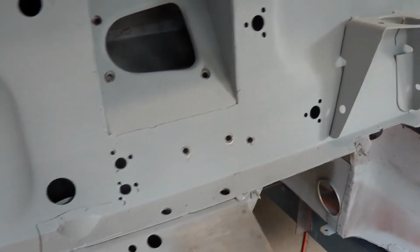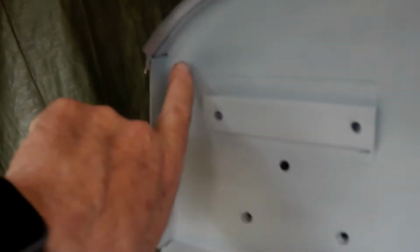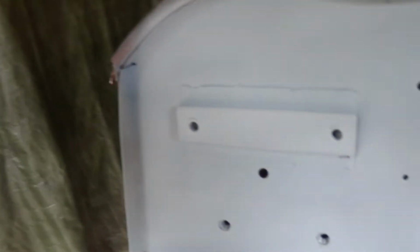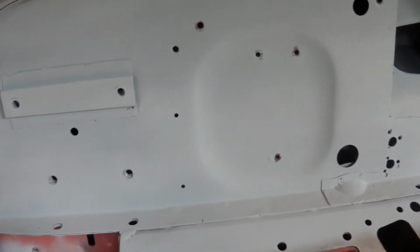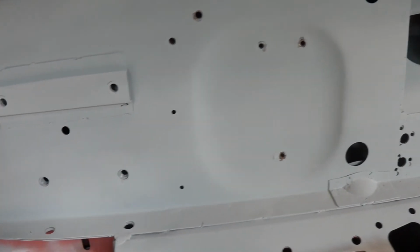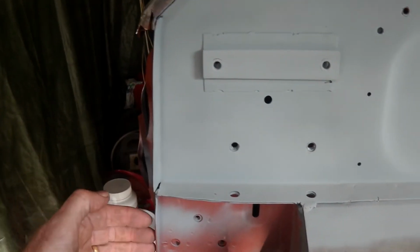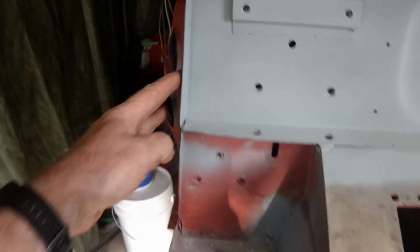So there was sealant all around here, around the edges there. So I thought I'd actually do that progressively. Actually sealant up in there, there's a gap between the panels, that was all sealed. So I'll probably do it progressively rather than weld everything in place and then start the sealant. So I'll start the sealant with this front bulkhead panel. As I say, I'll put these little side pieces in and make sure they're in the right position. I'll weld those. I won't weld the side panels.